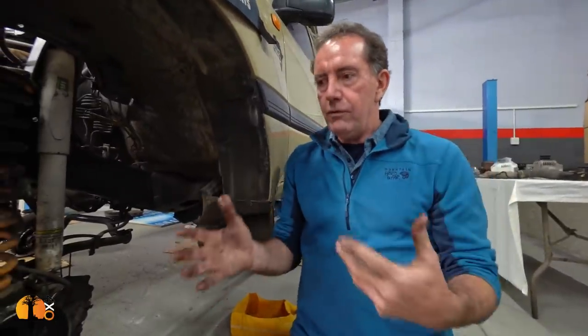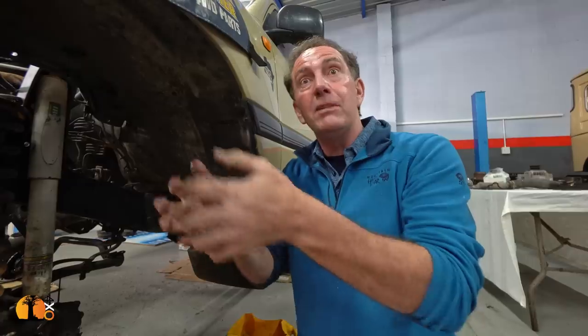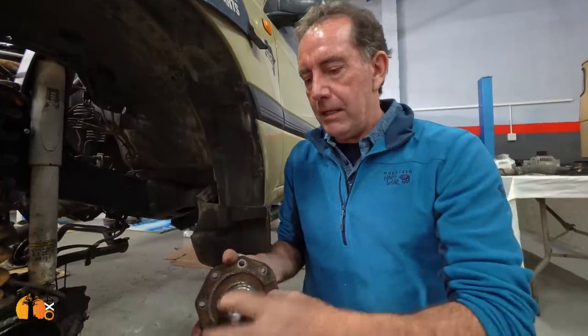Also, if you've driven through a lot of water — because the biggest problem people have is you drive through water, you've got a seal keeping the grease in and dust out, and as you go through water you cool everything down, quenching it, and you can often suck a bit of moisture through past the seal with dirt, mud, and grit. In a river with a lot of silt, you're creating a grinding paste, and that creeps in and you get excessive wear.